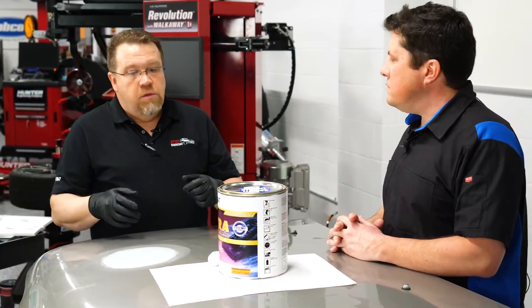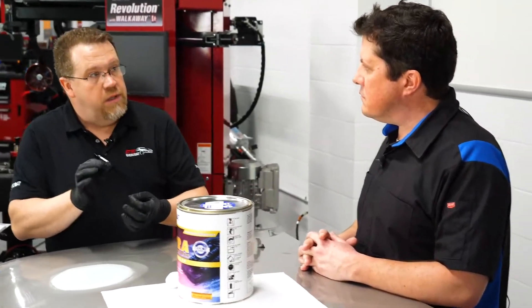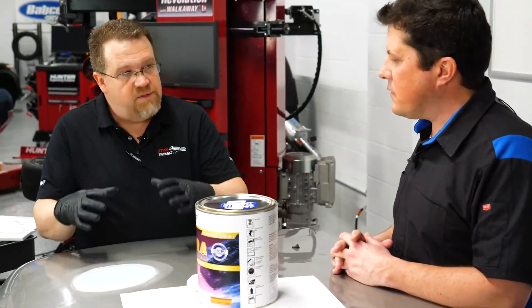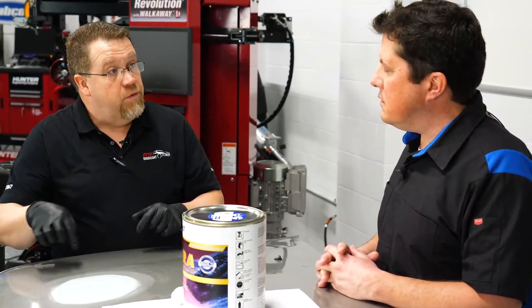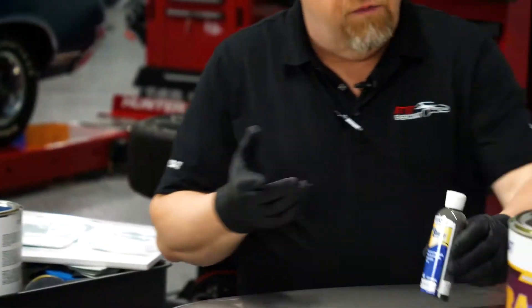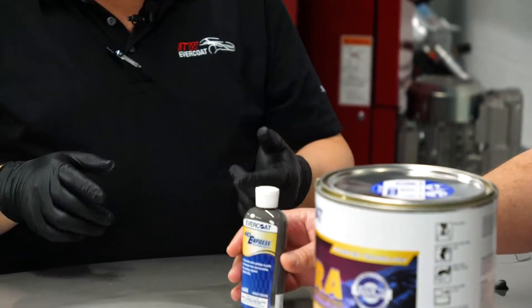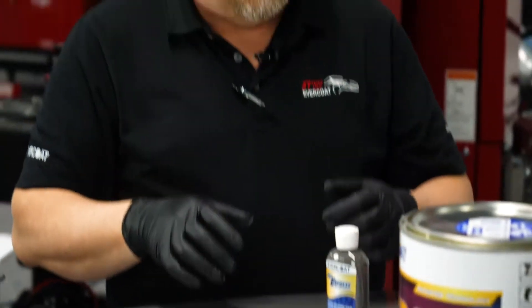So you'd apply the primer and then come back in after they flashed off and you'd see these tiny, almost sewing-needle-sized spots right in the area. Sometimes it might be in clusters; sometimes it might be around the perimeter of the repair. In order to fix those, we've come up with a product called 440 Express. This is a 1K polyester. When we apply it over the repair and it's sanded, it does two things: it helps define the micro pinholes — what I call the no-see-ums — finds them, fills them, and fixes them without any sanding being required for solvent-based material.